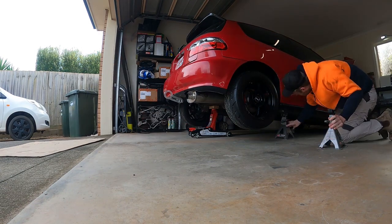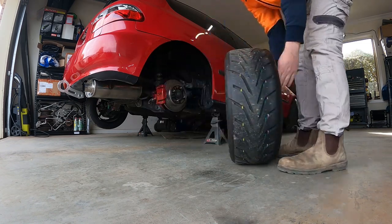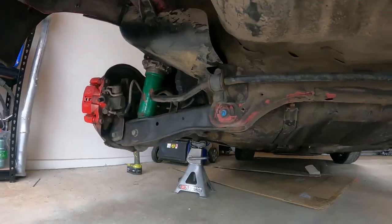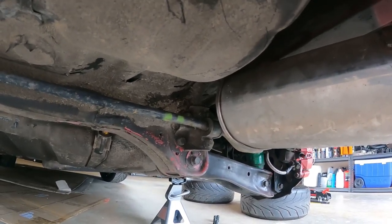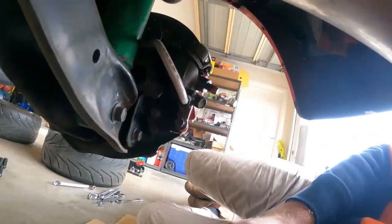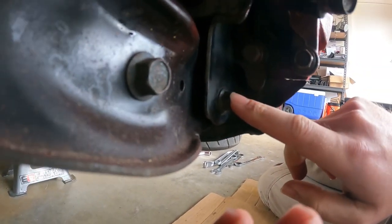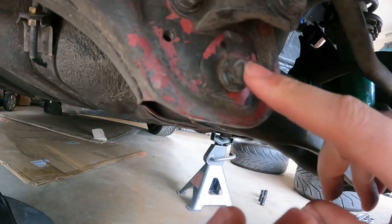So I was actually wrong — my Civic does have a sway bar. First thing I'm going to have to do is unbolt that one, get the subframe brace on, and get the lower control arms off. To remove the sway bar you just need to undo this 14mm bolt. Then for the lower control arm, remove the bolt holding the shock in, and also the bolt where it attaches to the knuckle — then everything falls down. Then remove this bolt on the subframe.